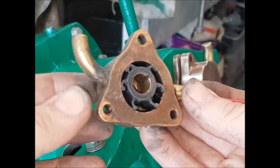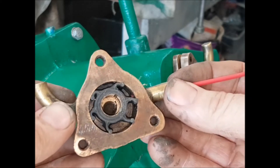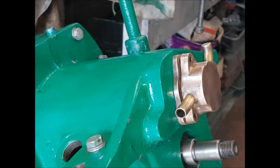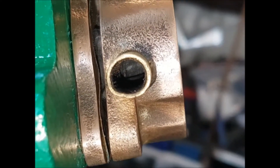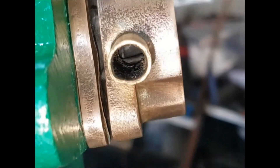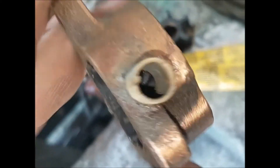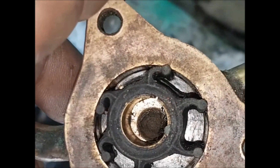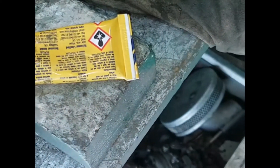If when you're rotating the crankshaft by hand you can't feel anything clicking this straw, it probably means the impeller's not turning — it may have delaminated. The other way you could put a mirror through here and look. It is just possible if you had a torch and a mirror you could look through the inlet hole to see the blades turning, but the two problems are it's very difficult to see through that hole, and it might be turning with no resistance.